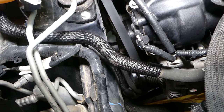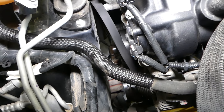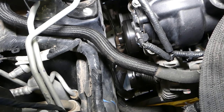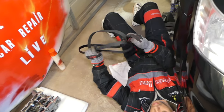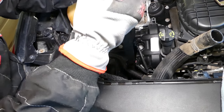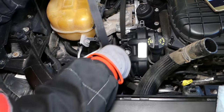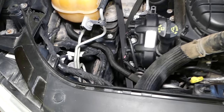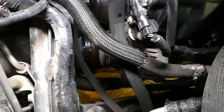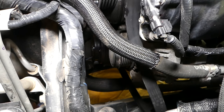Okay, we're removing the belt now and we have to remove the ratchet too. We'll see if it's easier to pull it out through the top or through the bottom. There's the belt. Now I'm going to show you the routing diagram as well — even though the thermostat and hose are removed it's still a bit hard to show exactly where it goes, but from here: the alternator is on top, then down to the AC compressor, then to the water pump.